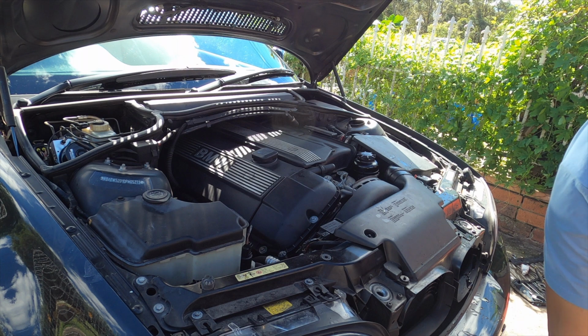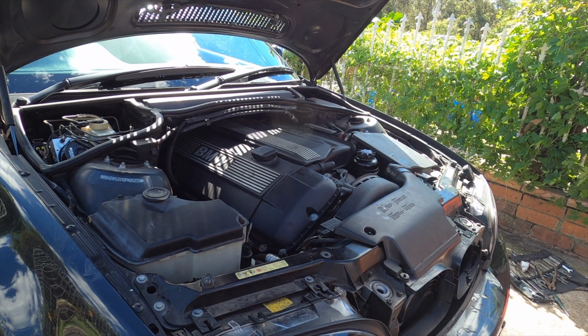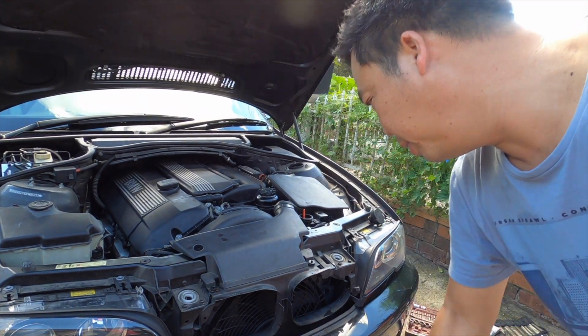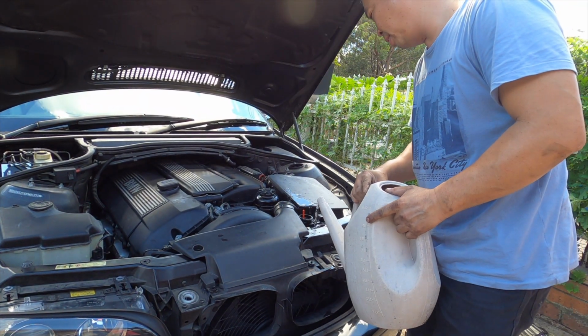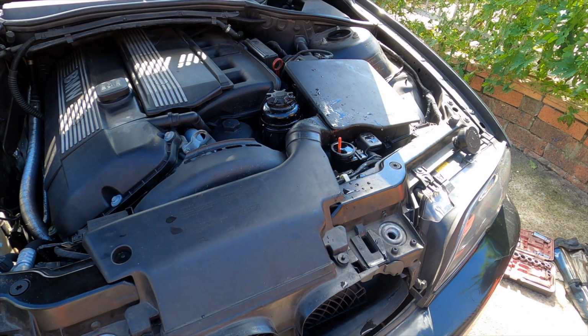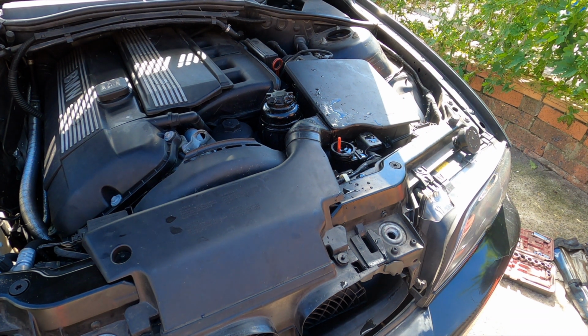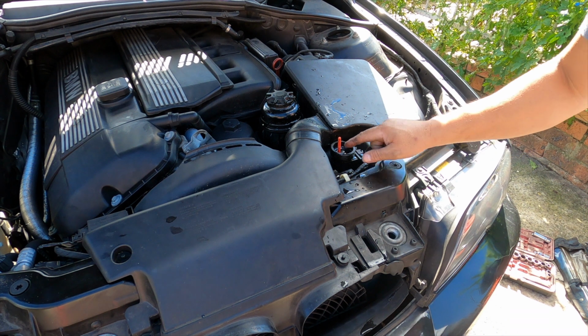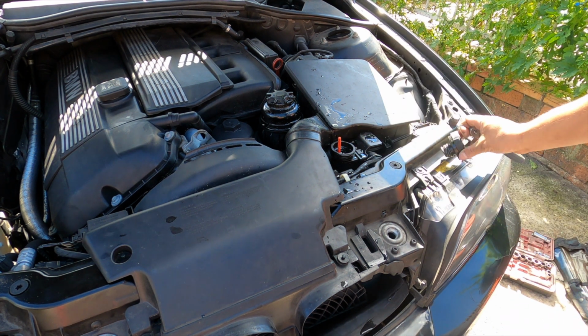Now we may stop the engine so it can suck up more water. We'll check the water again before we start up the engine. So it's coming down a little bit. Okay, now we try to start the engine, see how it's going. Water level, bubbles, nothing. No sign. The water pump starting to pump is good. The new water pump is working now.